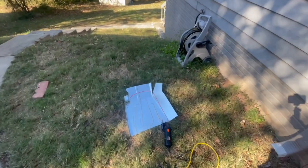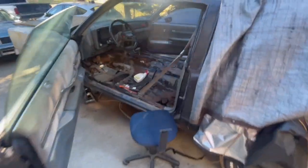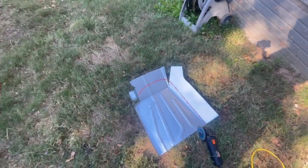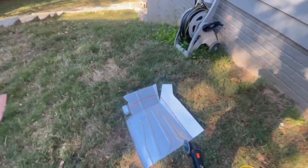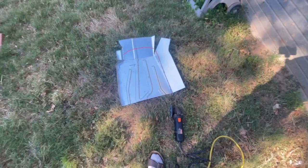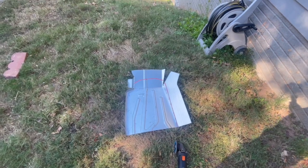We back — what's going on SleeperSport? This is the next day, we're here and this is what we got already set up, got everything opened up. We are cutting the floor pan on the red line to mock up the fitting — that's what we're doing right now. If y'all are going to ask me why I'm cutting it in the grass: the grass is moist and the sparks won't fly, and if the blade goes through I don't want it scratching the bottom of the concrete. So I'm just doing my cuts right now.